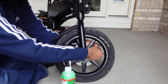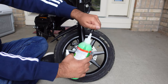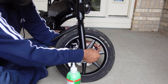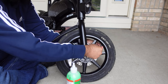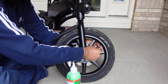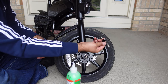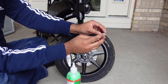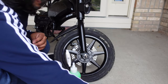Now remove your valve cap. Your kit actually comes with this black tool on top — it has a little slit here. What you're going to do is align this on the valve, and then turn towards the left. Just apply a little bit of force and turn left, and then this part — the valve core — comes out. Now you can put the slime through here. Keep this pointy part on the tool somewhere safe.